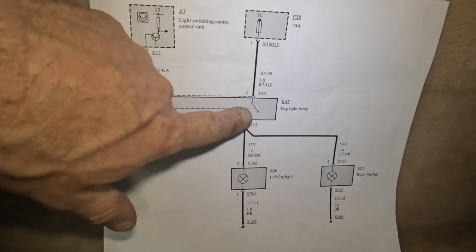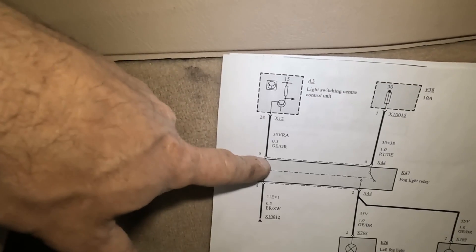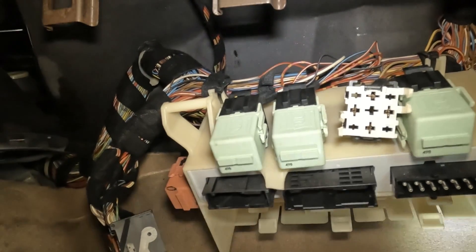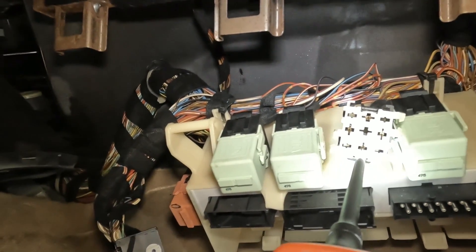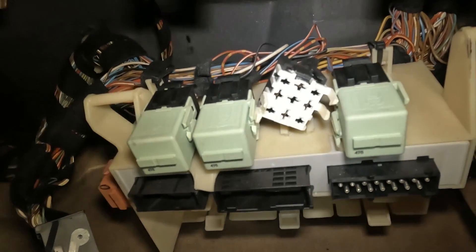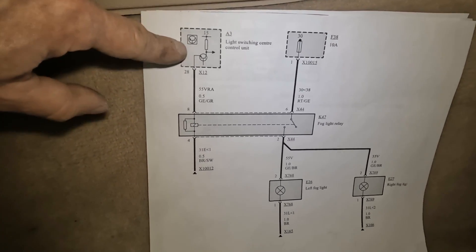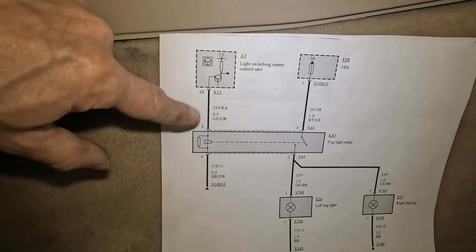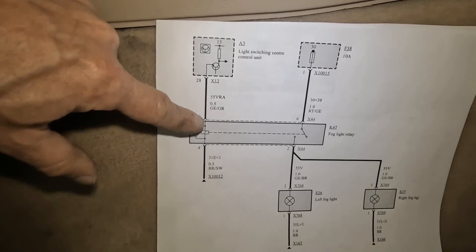So while it could still be a bad relay, we can still figure that out. With the key on, I should be getting power at pin 8 of the relay and I should have ground at pin 4. Let's check that out — I do have ground at pin 4, which is good. And I should have power at pin 8 from the module. Wait — there is no power from the module. That is probably my issue. Quick side note: if you don't have power here, remember you could have a break in the wire — it doesn't necessarily have to be a bad component. You would have to ohm out from pin 28 at the module to pin 8 at the relay to make sure you don't have a break in the wire. You could also run your own separate wire to pin 8 to overlay it.